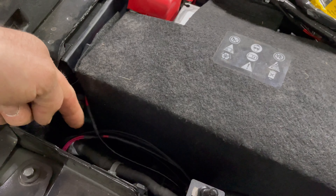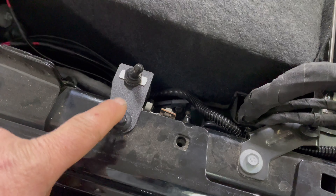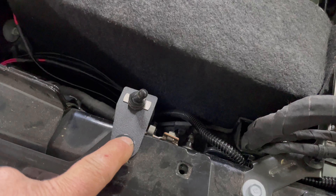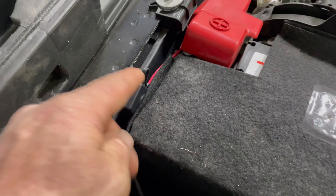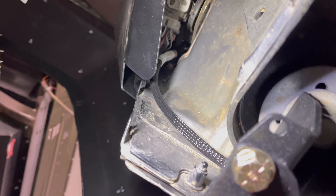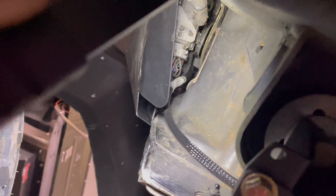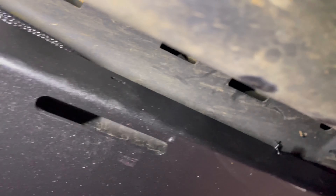The grommet is now installed. We've pulled up the wiring harness from the inner fender well and installed the cutoff switch on this 10-millimeter bolt — there's also an option with a push pin on certain models, but since this is a diesel it goes right here. This is the ground stud where the wiring attaches, and the fuse is tucked on the back side of the battery, attaching to one of the studs on the battery terminal. The harness runs down — this one also has Metal Cloak inner fenders — and they provide a clamp and bolt for the bottom side, then you run the harness along the slider using the zip-tie holes all the way back.